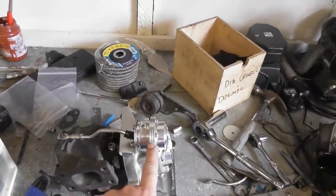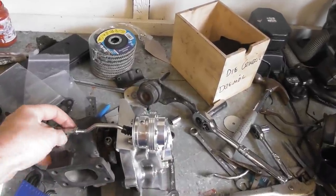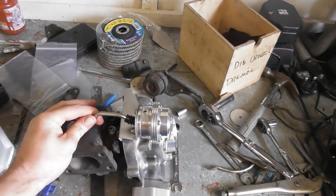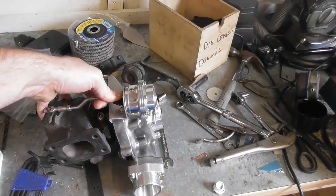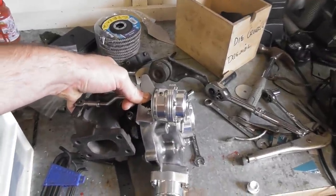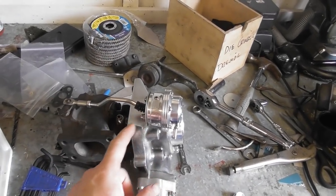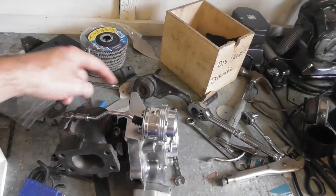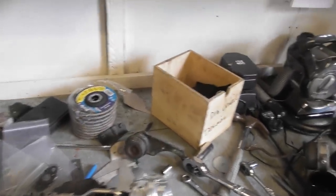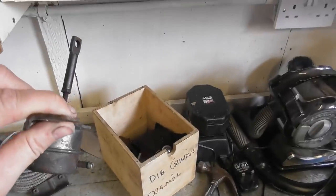Basically, in there's a big spring, and when you get pressure on there, it pushes that open. So obviously, hand strength is already pretty tough, so I can just about move it one-handed, left hand, but I'm going to need to put a brace in here or some gussets just to stiffen it up. My bracket is made of probably 2mm, and some of the other brackets that came off the originals are probably 3.